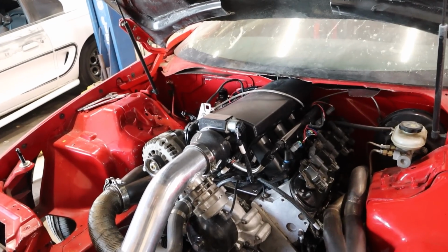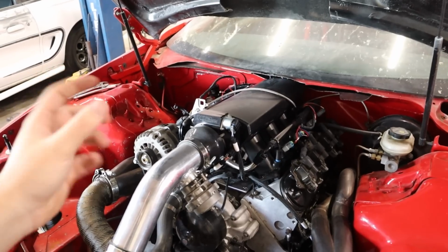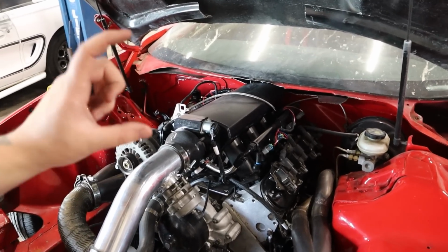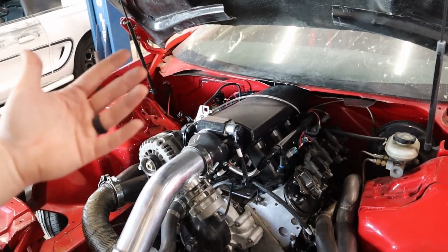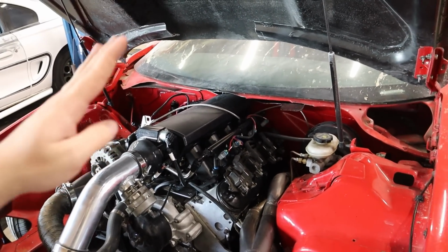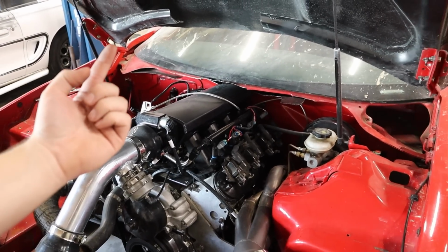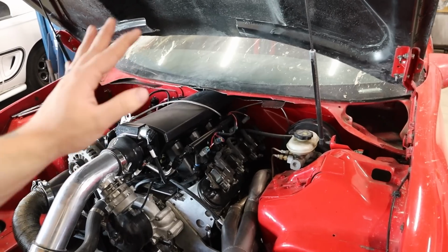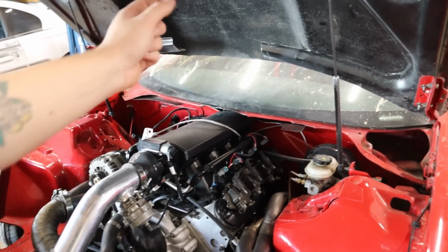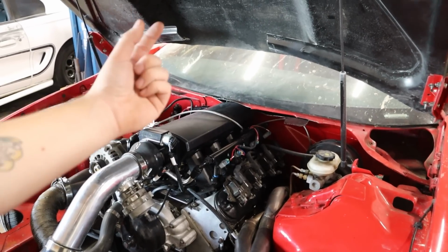The map sensor was kind of a pain in the butt on this thing, to be honest, because they have one of the Holley stainless steel type screw-in ones. Like it's a normal pressure sensor instead of a normal map sensor. So on the belly of this intake, there's I think 4 threaded ports. There's one that is half or quarter NPT, and then the rest are 1/8. I could be wrong. Anyway, the body of this sensor was so big that I couldn't screw it in next to the other ports because I didn't have a plug that would sink flush into the intake.